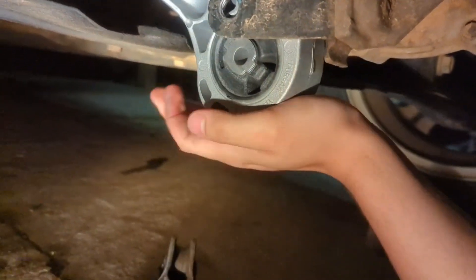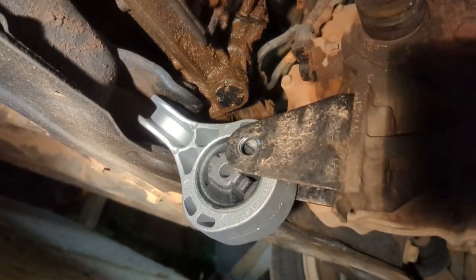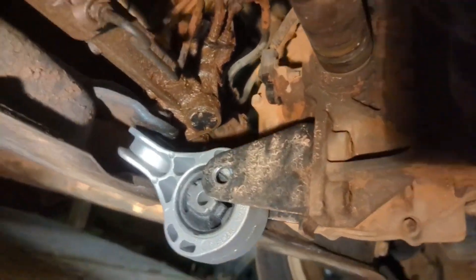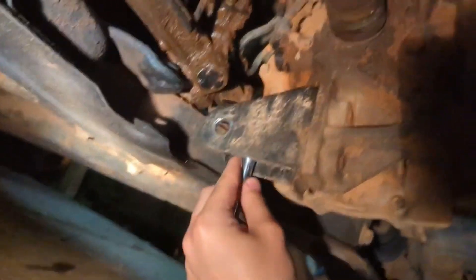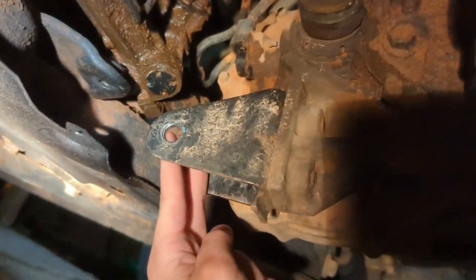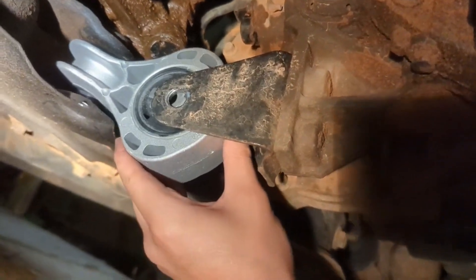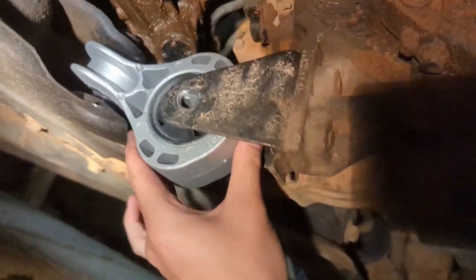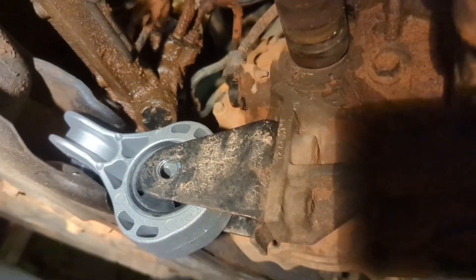Orientation doesn't really matter — just shove it up under there. One quick note: this bracket is a pain. What you might have to do is take your ratchet or socket and pry this bracket apart a little bit. I use three-eighths tools because they're so strong. You need to expand this bracket so that it actually holds the part properly and lets you put a new one in. Otherwise you'll have a very hard time getting the part in and out. Go ahead and pry it apart, or just struggle — whatever you prefer.